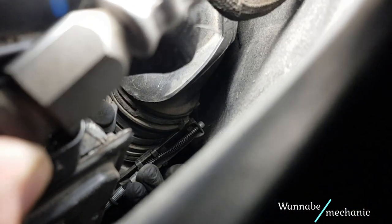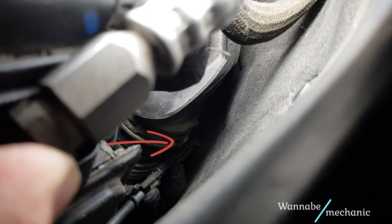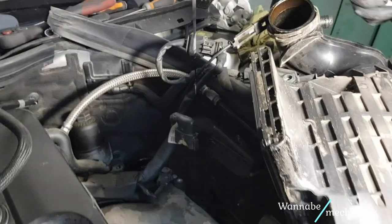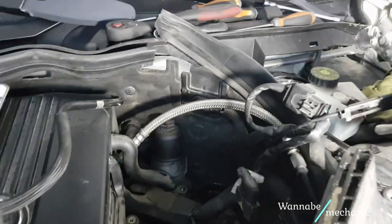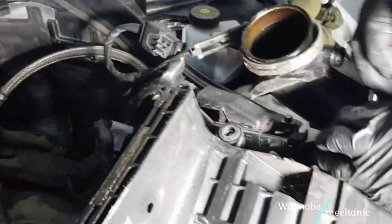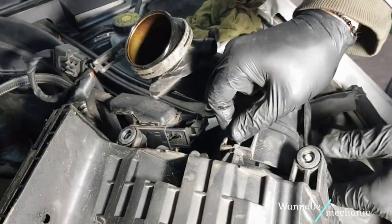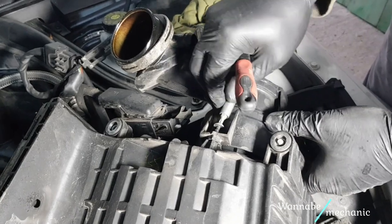Then use the collar flexible hose clamp pliers to release this collar clamp. I suggest you arm yourself with patience, and once you grab it, do not release the pliers. After releasing the collar clamp, you can remove the air filter's housing. As I said earlier, do not release the pliers or it will be very hard to place the collar clamp back on. Only now you have access to the bolt that I talked about earlier and separate the MAF sensor tubing from the air filter's housing.